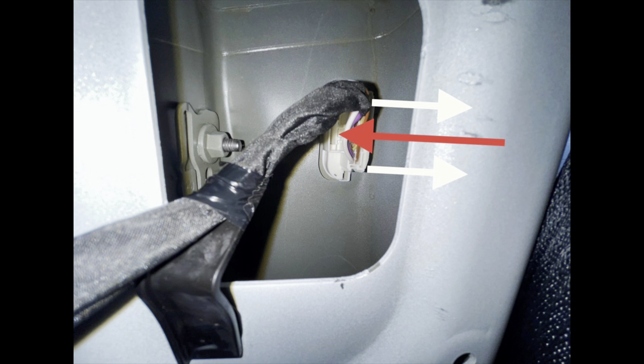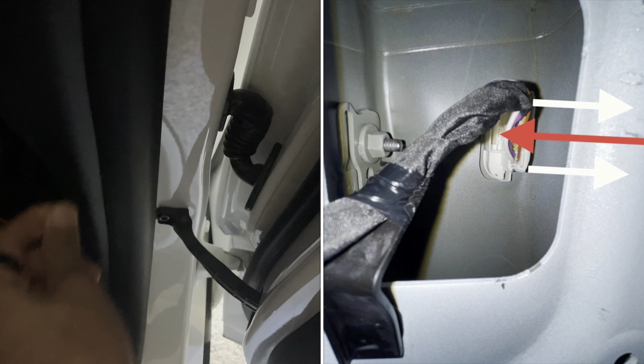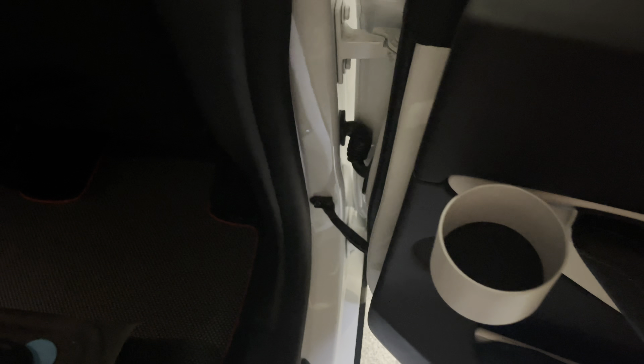You need this. In order to access it, you just go through the same process. You pull this back and there's a T25 screw right here. You take that out and pop this forward. Then you reach in — I'll show you a photo of where you put a flathead screwdriver in to pull the harness out — then you unplug it, shove it back in here, and use their harness to attach it. That's the key difference you need to install the rear door auto-presenting door handle.